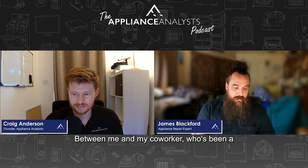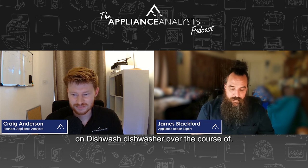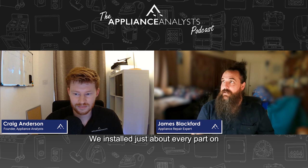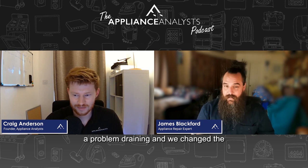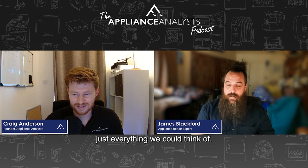Between me and my coworker, who's been a technician for over 30 years, we went out on this Bosch dishwasher over the course of probably 2 months. We installed just about every part on the dishwasher, and we were still getting an error code that indicated it had a problem draining. We changed the drain line, the drain pump, the board, just everything we could think of.